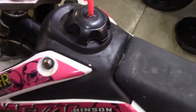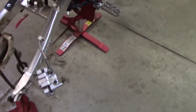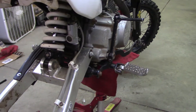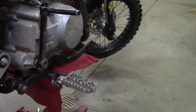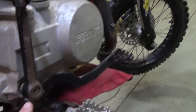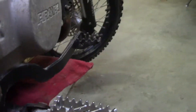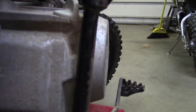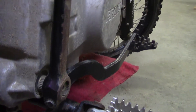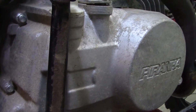I'm going to order a new chain and all sprockets. I haven't dug into the rear brake yet — it's not working at all and I might have to order the whole assembly. The kickstarter is in okay condition but it's a bit weird — it looks like it might have had a rubber pad that's now gone. It also can't go all the way up on the shaft because it would hit the case. Plus it's all mashed up — probably from boots rubbing on it.